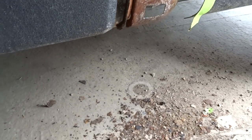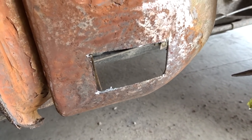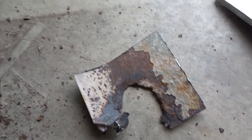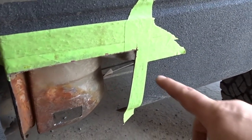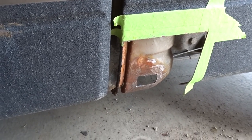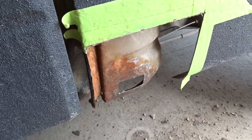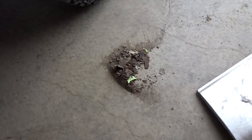Never fails — when you're working on a project it always goes a lot deeper than you thought. That was rusted out, so I'm gonna put a little patch panel in there. I cut this piece out and we can see the rust goes way back and even back behind there, so I got that whole patch panel for what it's worth. I'm just gonna go all the way across, call it a day. Gonna get set up, get this little piece in, start spraying some stuff on there and see what we can do. There's kind of a big pile of dirt and rust collected behind there.